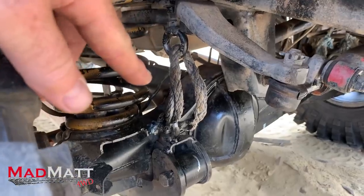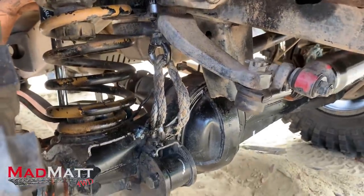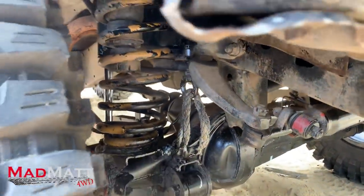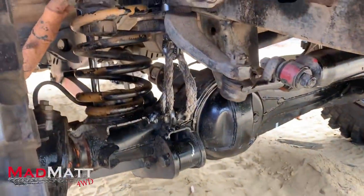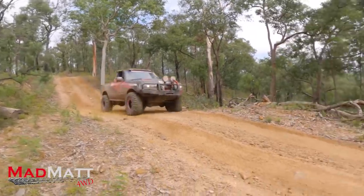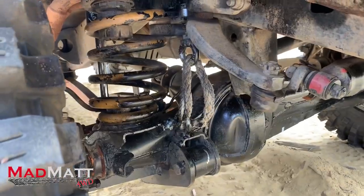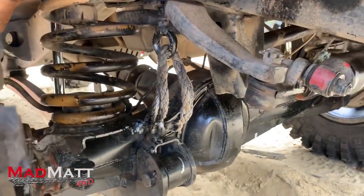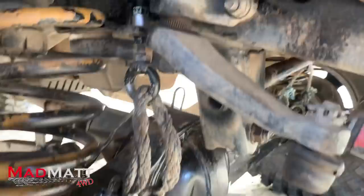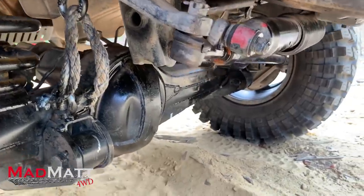This thing here, although it's actually working quite well, is my own homemade Mad Mat Specialized Custom Limit Straps. The design of these suspension systems is that on full droop — when your axle is furthest away from the chassis — your shock absorbers limit that travel. In a racing situation where you're jumping, you don't want to be smashing your shock absorbers day in and day out, so we often have a limit strap design. You can buy commercial units which work fantastic, but I had an idea and wanted to do it myself. It doesn't cost very much and it does work.